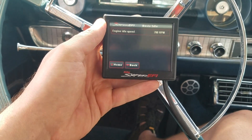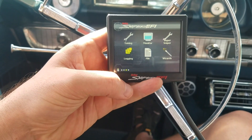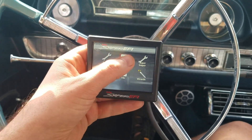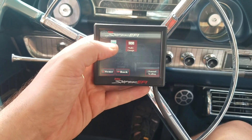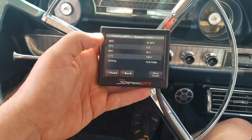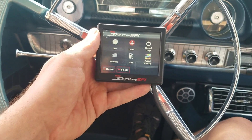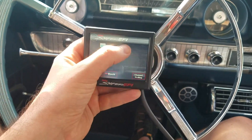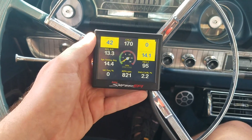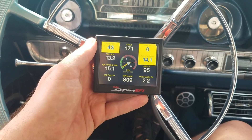I have no idea if I'm supposed to turn the car on or off for this. I think I just heard the idle go down. Let's go back to monitor. I'm slowly learning how to get what I want — I've been going to sensors. Back, multi-gauge, then sensors. And that looks like it took it down a little bit. Now we're closer to 800 versus 850.